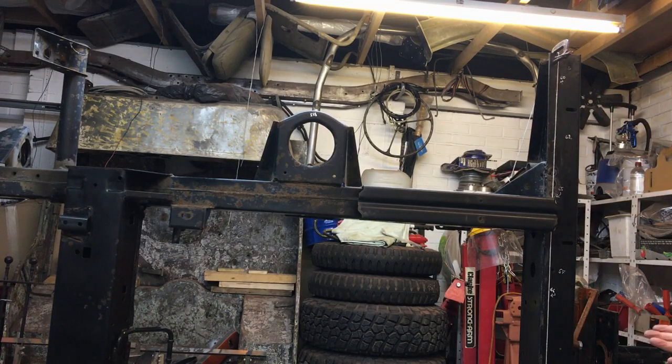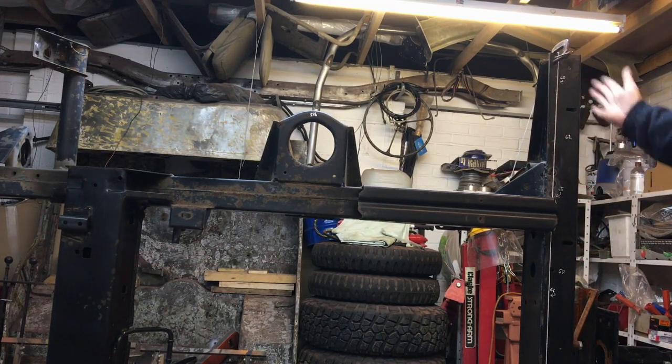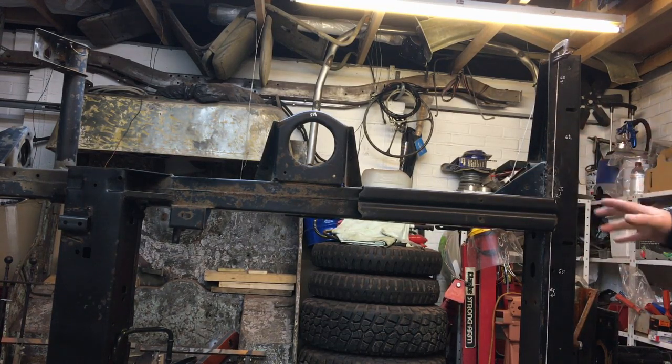So when it's actually on the Land Rover, this is sat in. The bottom of the door, where you've got that strip across the bottom of the door, comes along here, and then you've got a lovely straight line where it goes straight along, and you've got the cutout at the back where the rear quarter is, and this is actually sunk in. So if you put a spare wheel mount or steps or whatever on here, you've got to space it out to bring it out to the body by about 6 millimetres. I hate that. It just really annoys me whenever I see a TD5 and later Land Rover. They've always got that problem, and it's like GKN changed their clamping process during welding or something, and when they've done some welding in this area, it's pulled it all in. So I want to cut it about and pull it all out.